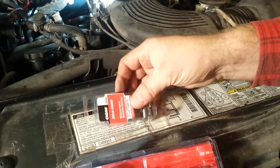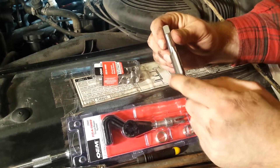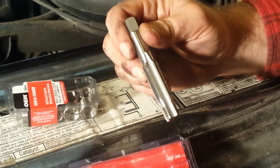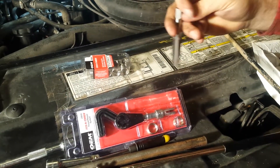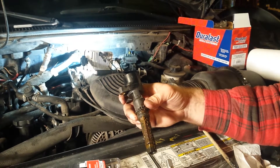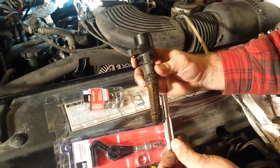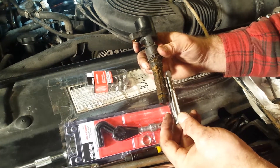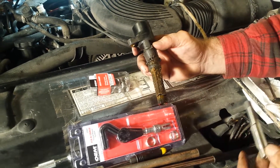It works if you get a little creative. Start with the tap. I'm told this two-step tap is a good shape, and it is very nice. Unfortunately, it's not long enough, because when you drop it down that hole you about lose it. Here's one of the real cruddy plugs I pulled out. It's down in there about like this — you've got to get several threads down there into where the plug is going to thread in, which means the top of your tap is below the top of the hole in your head.